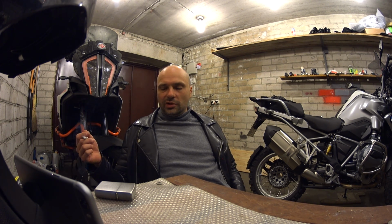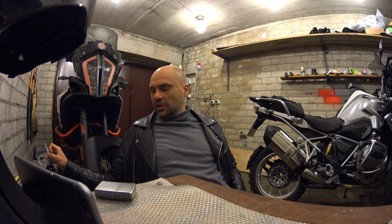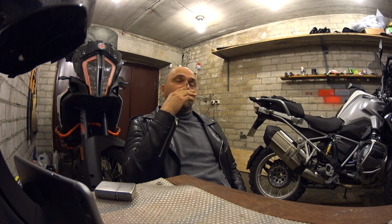But this is what it is. And the rebound damping in the front is strange. When you bounce the bike without applying any weight on it, it feels too fast. But when you do it with your body on the bike, it returns too slowly. So it's not quick enough, I think, but not by much. So it's somewhere near where it needs to be. But the rear is completely out, and the front compression damping is definitely not where it needs to be. Either that or oil level or insufficient preload. So I guess the only way to figure it out is to measure the sag and check the oil level and then play with the adjusters.